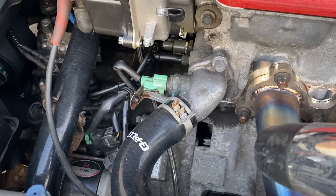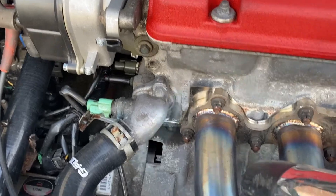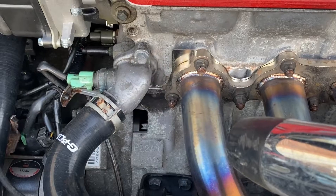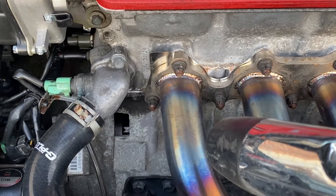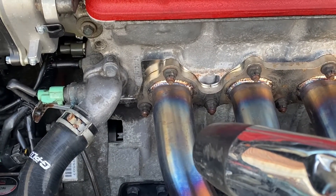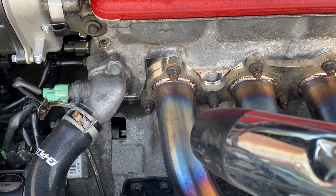I'm going to go ahead and squeeze the trigger. It's a little hard to see on camera, but we're going to basically turn that distributor and see if we can get that flashing lined up with that tab right there. Let me go ahead and put the camera down and show you guys what I'm going to do here.